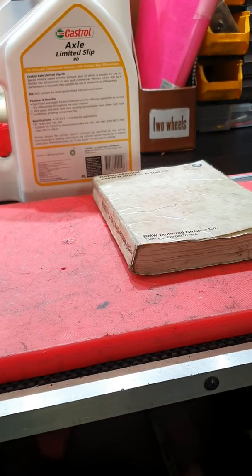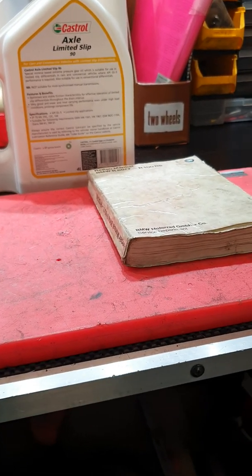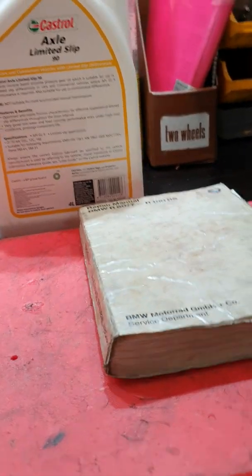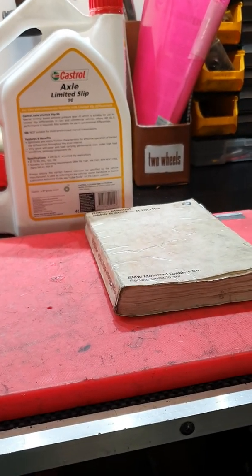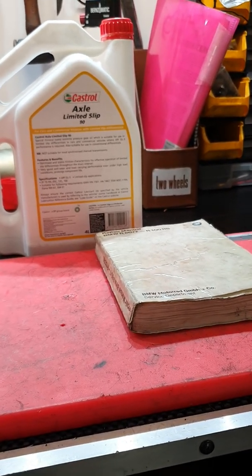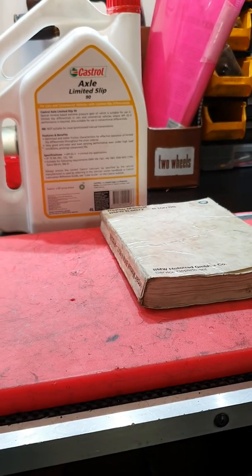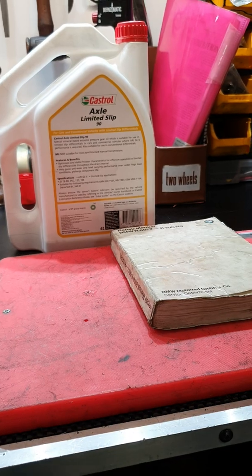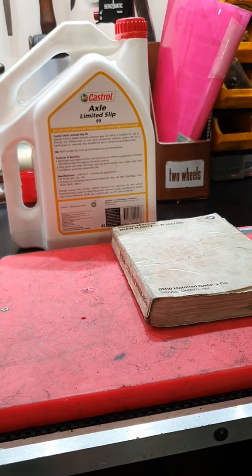Same with engine oil - I use 20W, the lowest winter spec in those oils, 60 Penrite oil with a high zinc level. I use it in all my customers' bikes and all my own bikes. I will not use 10W-50 because when you put that oil in and it gets hot, you can hear the engine - it's not knocking or banging, it just becomes louder. I believe the film of oil is thinner. I use 20W-50 or 20W-60 in the best zinc content oil I can buy.